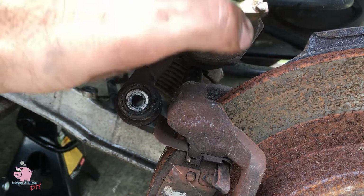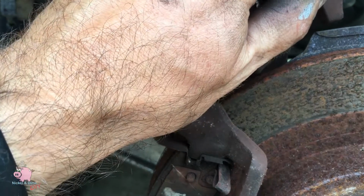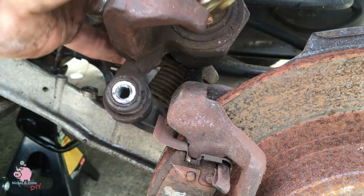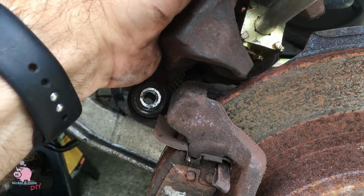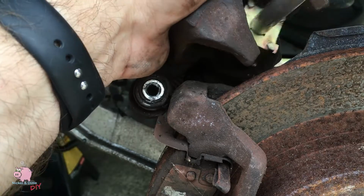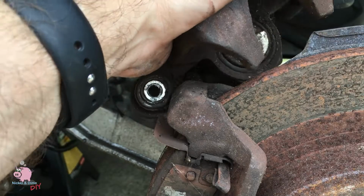And you need a special tool to spin these back. This cube is great. It's about 10 bucks. Links in the description. Got a whole bunch of different sizes on it. Works great. Chances are your caliper is gonna take a little bit of effort to spin it back. As long as you keep steady pressure on it and twist and turn, as long as it's spinning, you should be good. It's probably gonna take you a little bit, but it just is what it is.